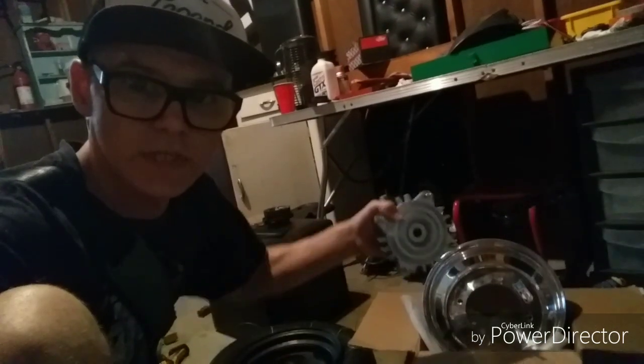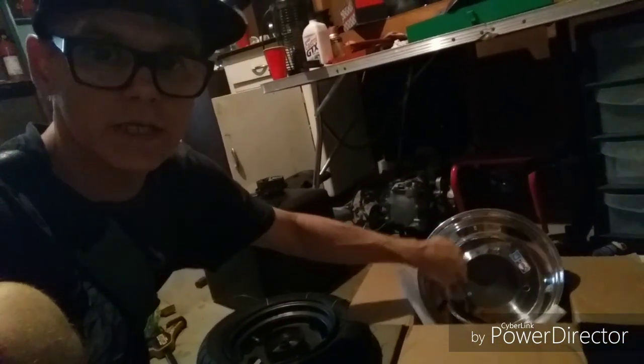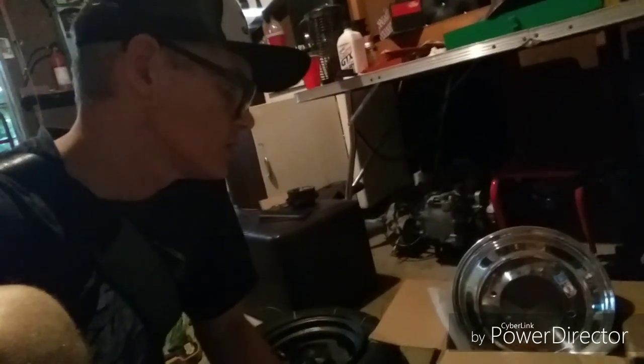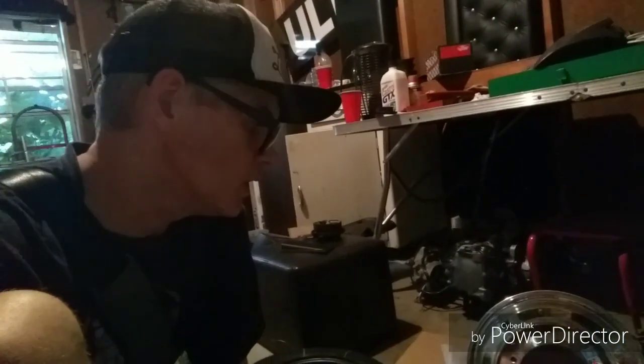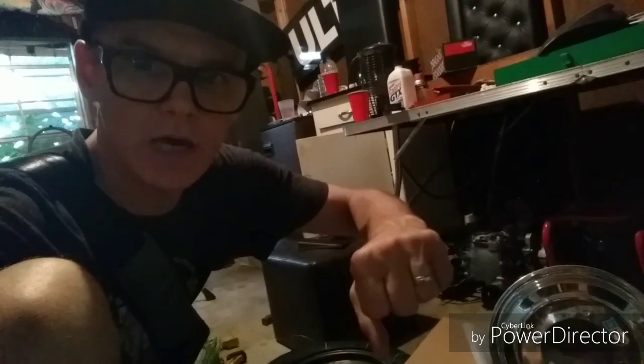This has a Kimco hub. What they do is they drill into it a bit to expand the holes and move them a little bit closer. They also open up the inside so that the hub fits flush in there. They also put a note on the box for the hub to remove the studs, and they've included bolts to use instead. I'm going to run up to Home Depot, get two bolts that fit, and then when I tighten them together I should be able to grab the stud and screw it out of the hub.